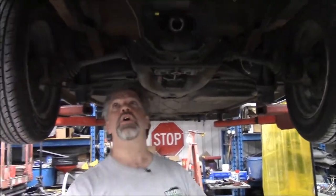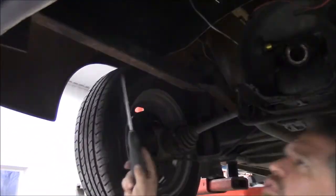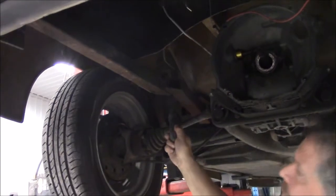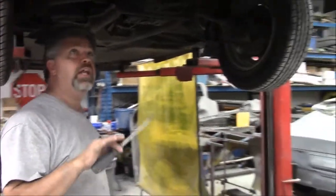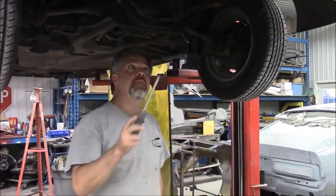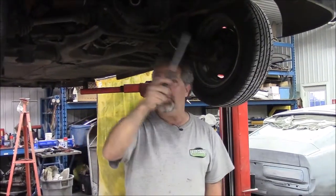We're going to be changing that on this Porsche kit car. As we come towards the back — also a play on words — when the seller was telling our client it's a total custom tubular frame, you can see that they have square tubing welded from here to the back, but you need that to kind of hold the back part of the body. It's unfortunate that our client didn't have a chance to properly inspect it. Because the car was lowered, it was foul weather, and the man sent several photos of the car that looked like a great deal. When the deal seems to be too good to be true, perhaps this case makes it evident. This is not a custom full tubular chassis — this is a Volkswagen pan with some tubing added to it.